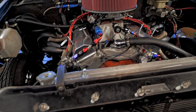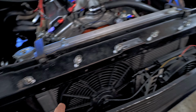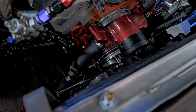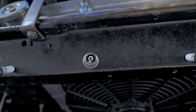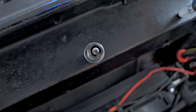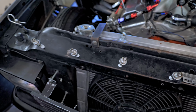Well, all right, guys, that's enough. I'll leave you with the last tune-up that I had, which was a 62 nitrous and a 59 fuel. And all I did was pull about a half degree more out in timing. You can do that right there pretty easily with that crank trigger. It's pretty awesome. And as you can see, timing is definitely different for about every single one. So yeah, you gotta pull all your plugs on nitrous and look at every single hole.